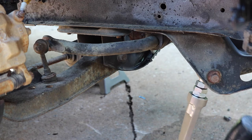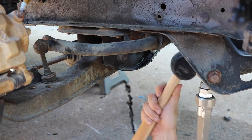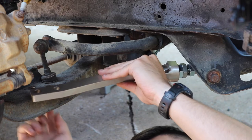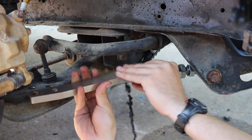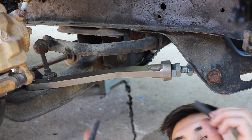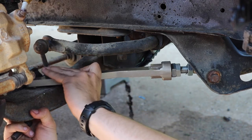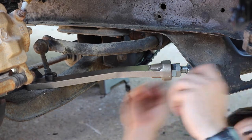Pro tip: make sure your tension rod is on top of the control arm before you start putting it in. If you go to line up your tension rod and the bolts don't line up, you can always adjust it out to make sure it fits in - super simple. ISR was nice enough to supply us with some new bolts for the control arm, but I may have lost the nuts. Just a heads up if you do get some ISR arms - could not find the nuts for these bolts that they gave us.